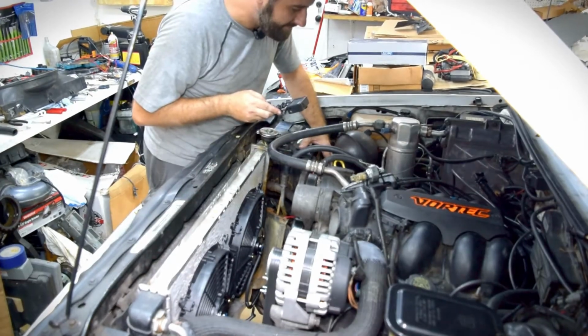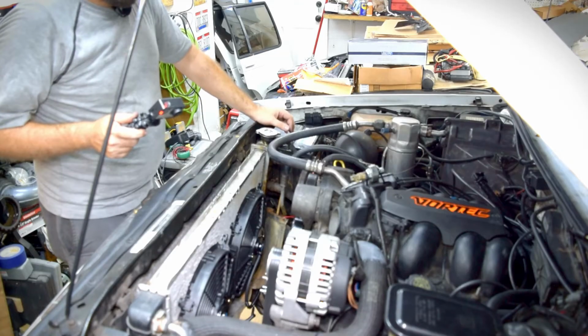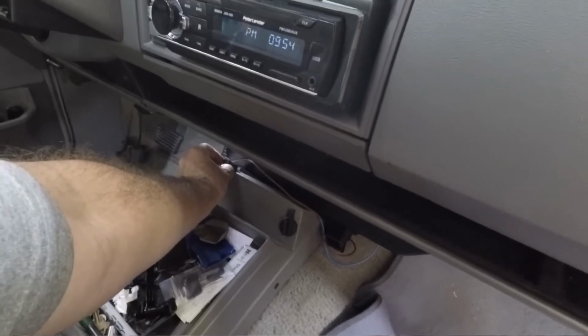My two inline fuses for the power are connected to the positive terminal of the battery there, like I talked about before. For the ground wire for the fans, I just connected it to the inner fender over here. The fans are all good and they do work. So ignition, and then just temporarily, I've got this little switch down here. Click that, and the fans run.